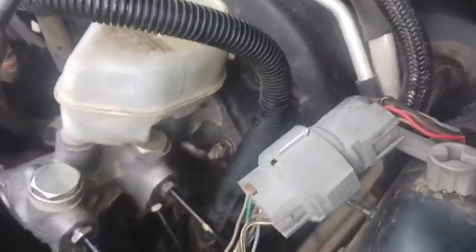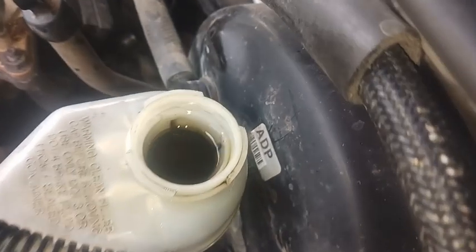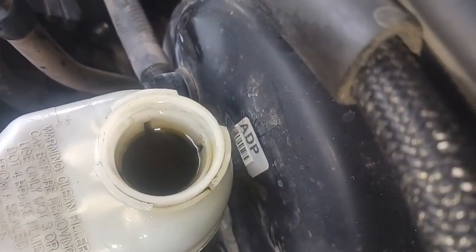So I'm in the car. David didn't have any brake cleaner. Oh well. So I went ahead and wire wheeled the booster, got the master bolted on, got all the lines hooked up and tight, topped it off with brake fluid, and I'm just pumping up the brake pedal. Here, David, you want to show that fluid? It already feels way better than it did.